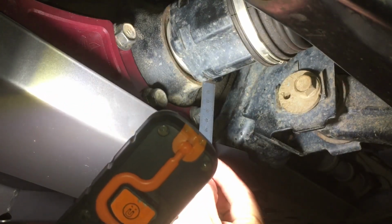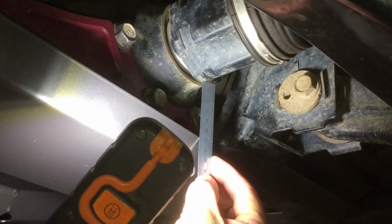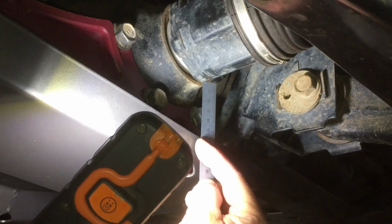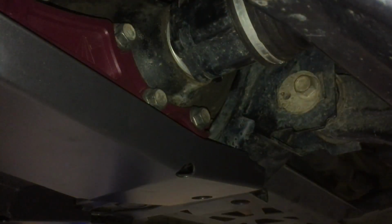It's certainly not 10mm difference. I'll call that exactly the same, 59. I was going to call 58.5 on the other side. Anyway, close enough to say that's 59 as well. Right on the fold, that's right on 59. And 61, can you see that? Within a millimetre or spot on side to side. That's how vehicles should be engineered.